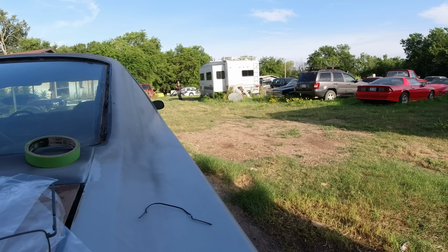Okay, so right now, got all this sanded here. I'm gonna mask up these lights and paint this black and paint up all these deals here and paint them all black as well. There's some other stuff I wanted to do, but I can't think of them right now. Oh, the door. I want to do the passenger door first. That is the driver's. That's the passenger. I'm going to get that passenger door over here on a tire and sand the jamb on that.